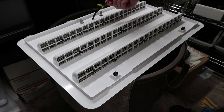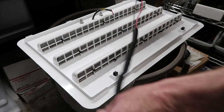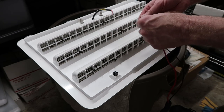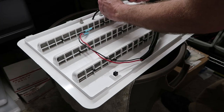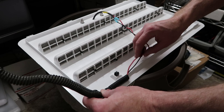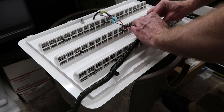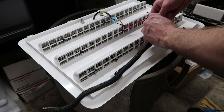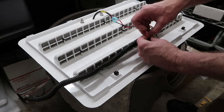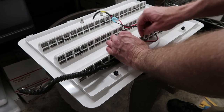On the back side of the light we've got the wires, and I've got a little harness built up with a mating-style disconnect plug that'll plug into the plug on the camper. I'll strip my wires back. I probably made this wire longer than I needed to, so I'll take up some of that extra slack by routing the wire over this way a little bit. The reason I'm installing a light is because on the passenger side of my truck camper there is no outside light.